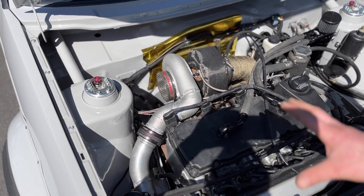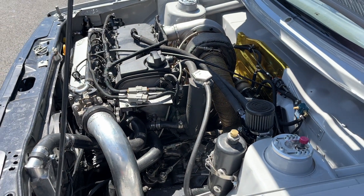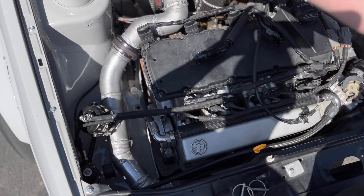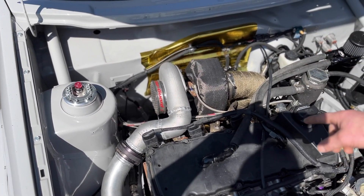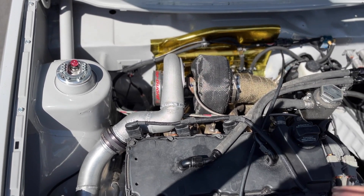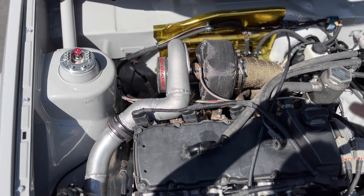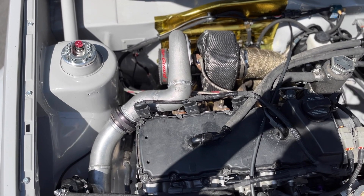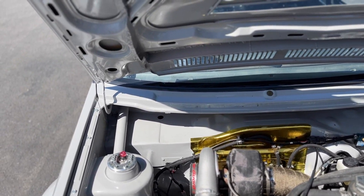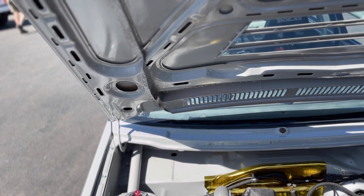The engine head is the same with 268 cams; he added Super Tech valves, valve springs, and titanium retainers. The turbo is the same size but a built wheel version — upgrading from a $300 to a $500 turbo. Bosch 2100cc injectors from VS Racing, along with a VS Racing wastegate. There's a fancy tubular turbo manifold to run EGTs, but honestly he's not impressed — it's disappointing. The car lost a bunch of mid-range power compared to the $40 eBay manifold, though they've largely sorted it out through tuning.